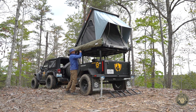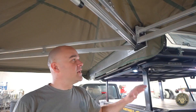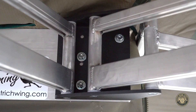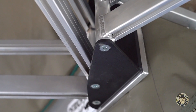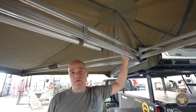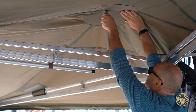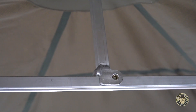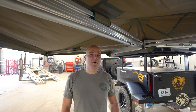When it's closed, it's eight foot five inches long — this thing is enormous. The hinge assembly is made from 1050 alloy and the arms ride on nylon bushes for smooth deployment. The awning roof is pitched using a riser to ensure that rain runoff is assisted and to give a more spacious feeling underneath the awning.